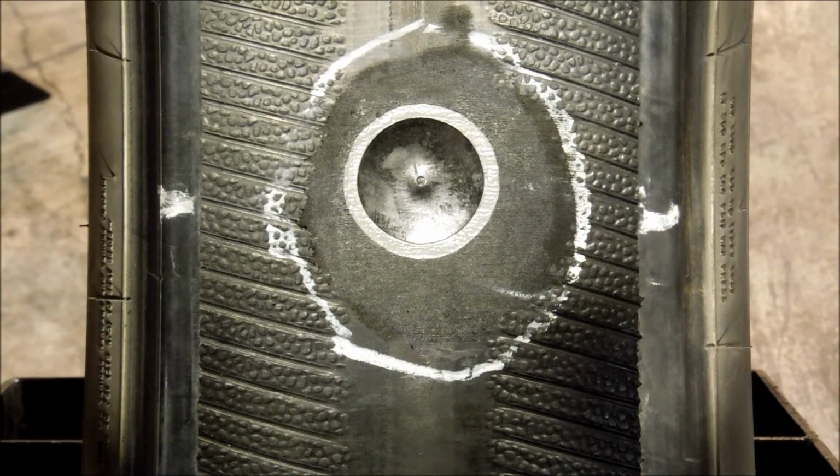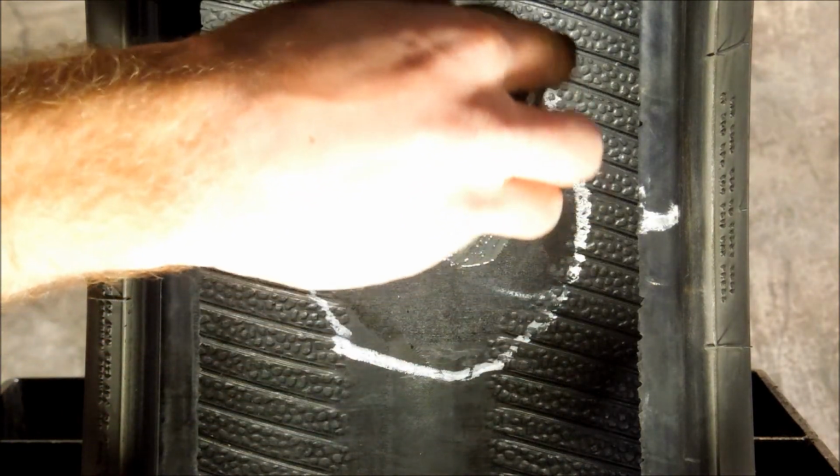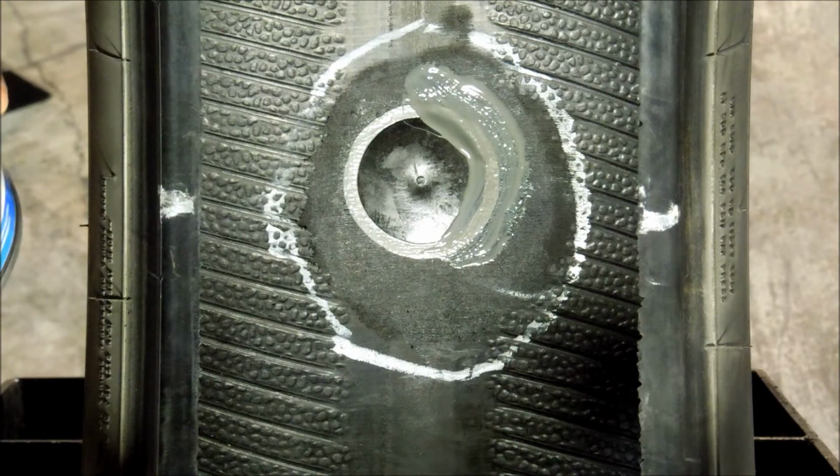On a tubeless tire, apply a coating of inner liner repair sealant around the perimeter of the repair unit and to the exposed texture area of the inner liner. This will aid in the air retention where the inner liner surface has been exposed.